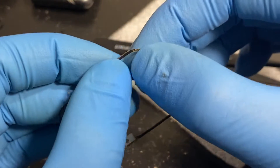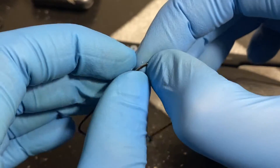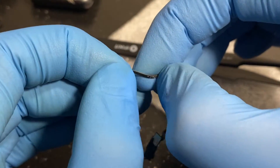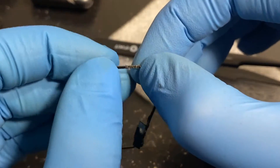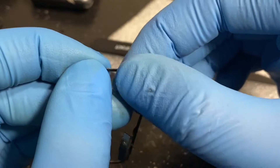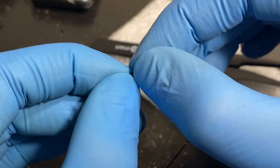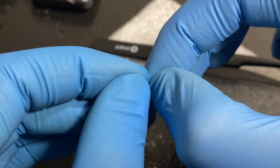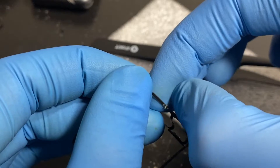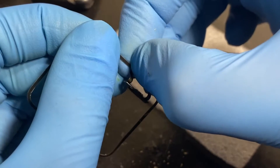The glue at the bottom is not coming off like the glue at the top — I can just scrape the bottom glue off with my glove and it's flaking off. For reassembly, I was going to use B7000, but that's a bit much for an Apple Watch. B7000 needs more heat to loosen, and since we're using an OLED display, too much heat is a concern.